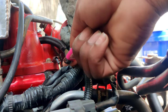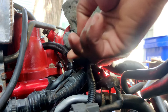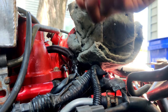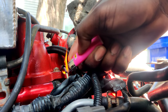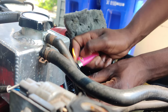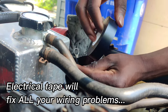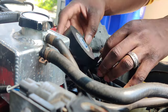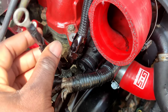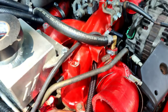Just so everyone else knows, I have never done this before — well, like one other time for the knock sensor, but that was really it. It took me an extra second because I don't have wire strippers, but I got it down to just a ground wire. Now I'm going to measure it up, shorten the length, use the heat shrink. Ow! Definitely putting the camera down. That is not pretty at all, but honestly I hope it just works. So get this back on there and we will try to start the car one more time.